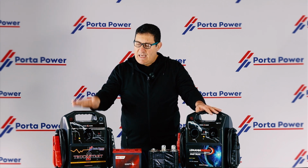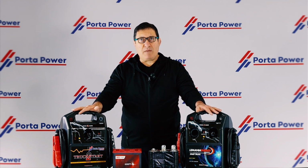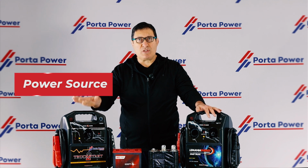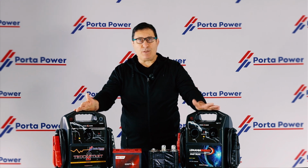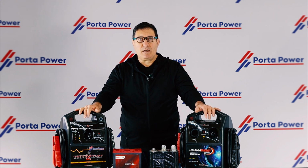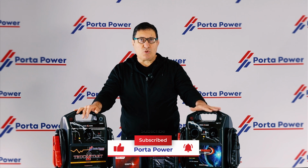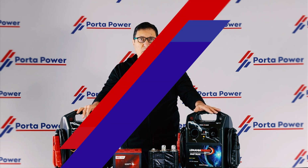So in the case of a traditional AGM booster, AGM boosters also can be used as a power source. So you can actually use this booster here to power your camping fridge or other things that you want to use it basically as a power bank. Whereas the capacitor, you won't be able to use this as a power source.